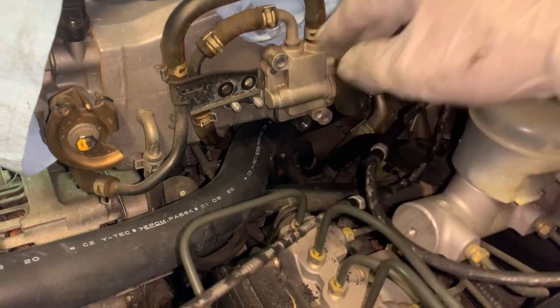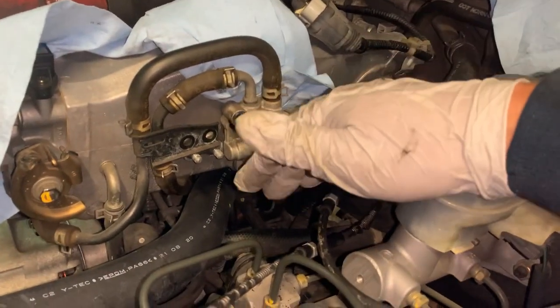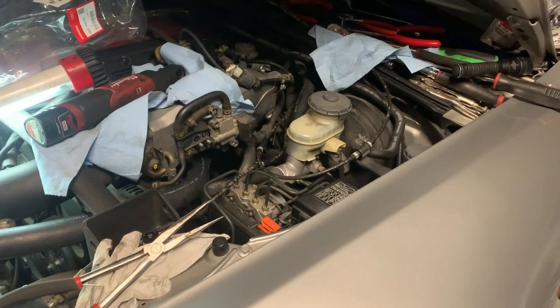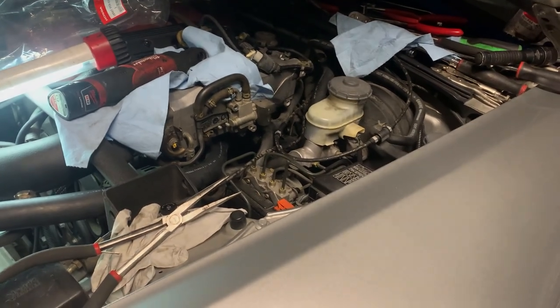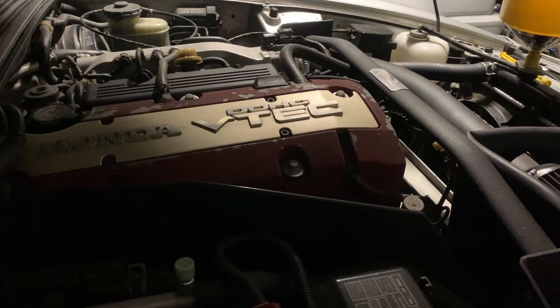Had to remove the IC off of it — two brackets: the intake manifold bracket and a bracket to the wiring harness where the cruise control cable gets held. All that was in the way. Also had to disconnect this air pump hose right here — a smog device — had to bend it back so it routes this way, then goes onto this little diaphragm flange. Just like they like to say in the Honda manual: do the reverse of what you did and you're good to go. Bracket's back on, wiring harness clips are where they're supposed to be — beautiful.